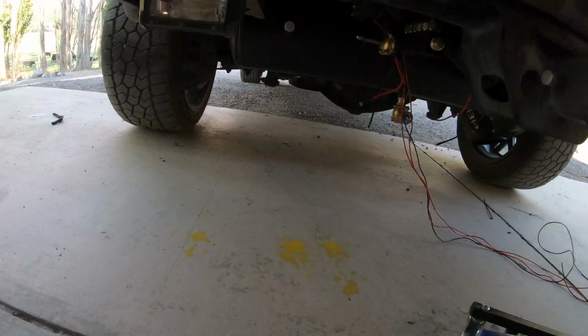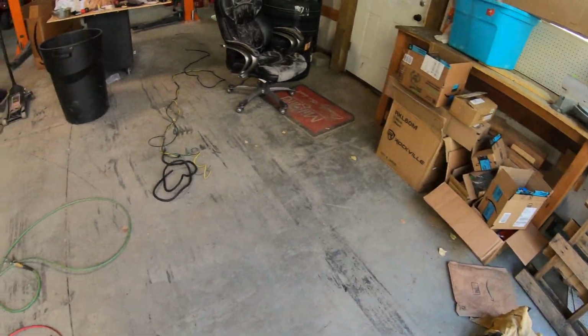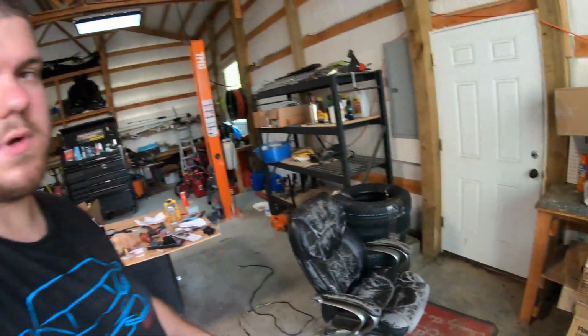Well, here's running the wiring. There's a harness I made. So I have to run a battery, nice good fat cable, all the way back to the compressor. Then I need to run 2 signal wires to the cab for the 2 solenoids, and a 3rd wire to the cab from the back for the switch, so I can shut the whole thing off before I leave, or whatever, lock the truck. And the pressure wire, so 4 wires total I need to run to the cab to read the pressure, so I can see what the pressure is in the tank.